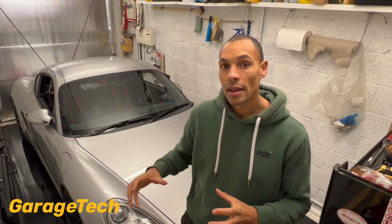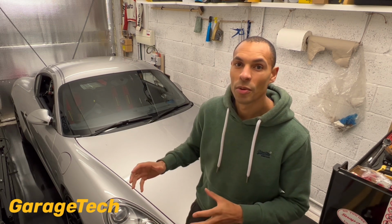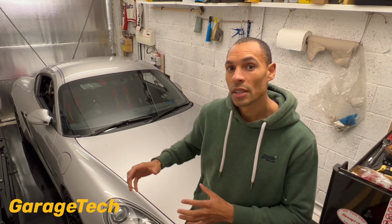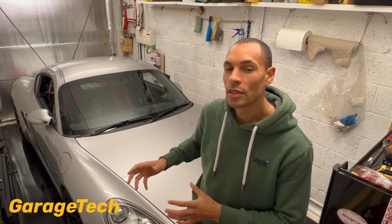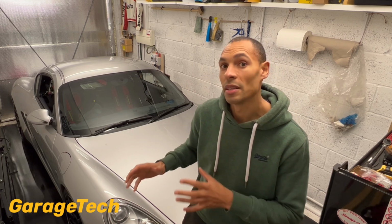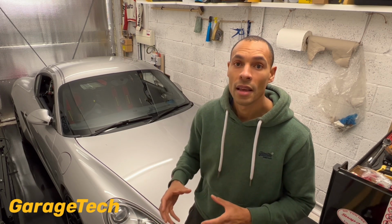Next then, let's have a think about your tyres. So obviously, ideally what you need to be doing is rotating the tyres probably every 30 days just to try and avoid getting those flat spots. Now, obviously the modern vehicles with newer tyres are not so bad and not so prone to developing flat spots when they've been sat for a period of time, but there are some things you can do to help try and prevent that even further.